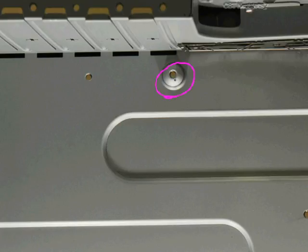The reason why you have to have this bump is so that it puts some distance between the bottom of the motherboard and the floor of the case right here, so that you can have some ventilation and free airflow that goes through there. You don't need a whole lot. Most of the heated components are on top of the motherboard, but underneath that you'd still want some ventilation there. So in this particular motherboard, the standoff, if you will, is already included, but there are certain other types that you should be aware of here as well, and more likely you're going to see something like this, if I can find it.